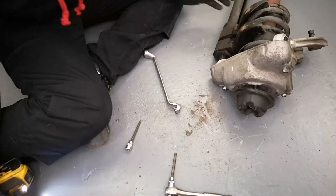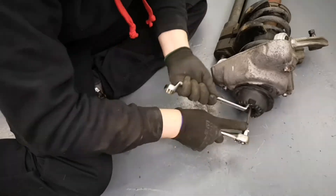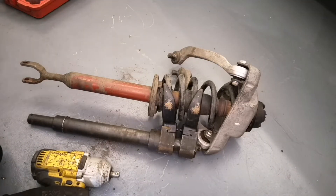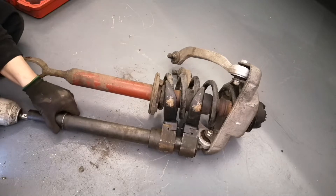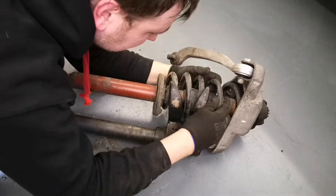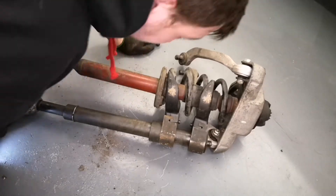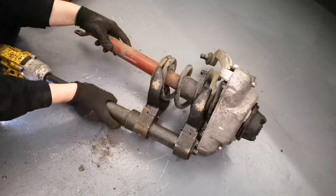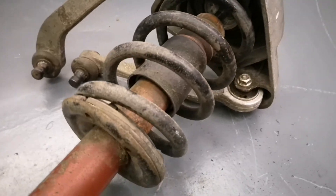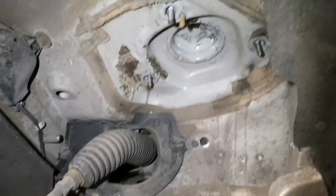Back together now. The same problem — can't lock it off, so I'll do it by hand. Now I need to carefully unwind the spring and make sure it goes back in the location marked, which may be easier said than done. Perfect — I think you can see that, lined up nicely. I'm just going to check the strut top is tight once again and then we're done.